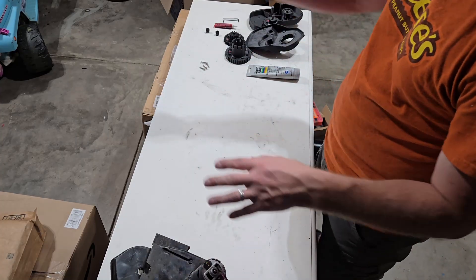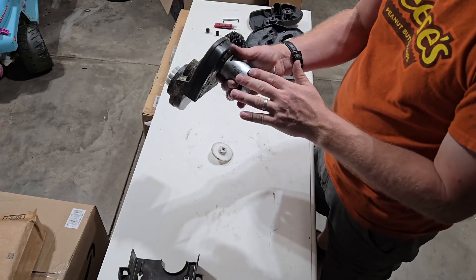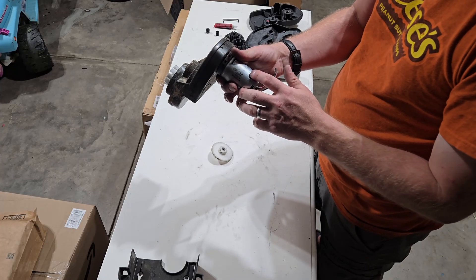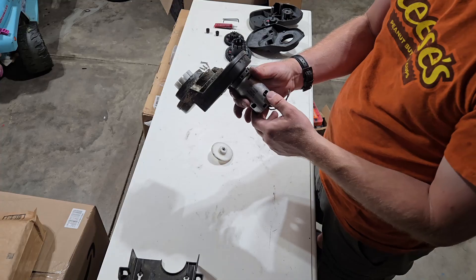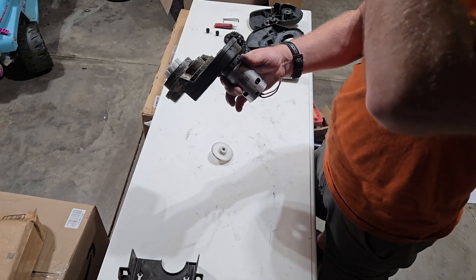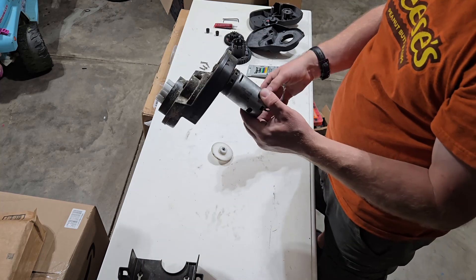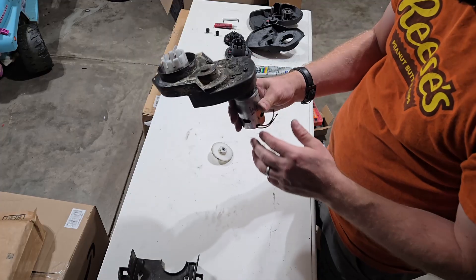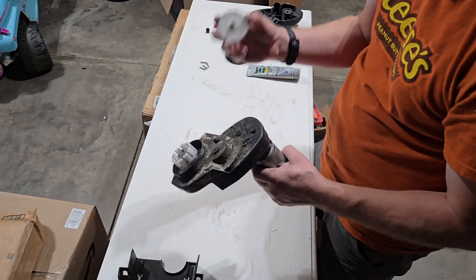That's what we're running in the Jeep because at around 24 volts — this is the Johnson 887 motor, at 18 volts it's rated for 23,500 RPM — and we're running about 10 volts higher than that. I didn't measure the unloaded RPM on these motors at the two lithium iron phosphates in series, but it's probably in the 30,000 RPM range. With a 23-tooth pinion gear, these things are cooking.